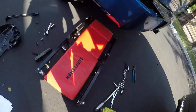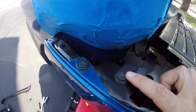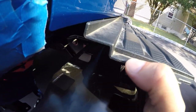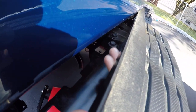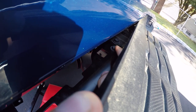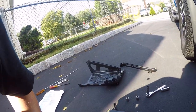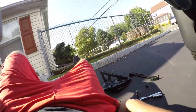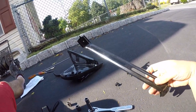The reason you need to get to those clips and lift the bumper up is because this is the factory bumper bracket that has to be replaced with the one that came in the kit. In order to do that, there is a 12 millimeter bolt and another 12 millimeter bolt under this bumper. You need to loosen everything enough to be able to pull it off and undo everything — it was a little difficult to get that bracket out.